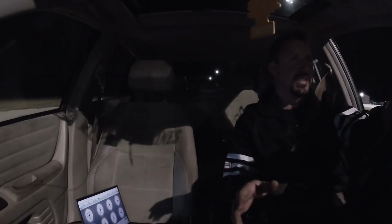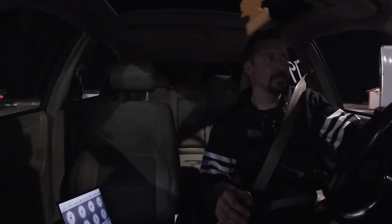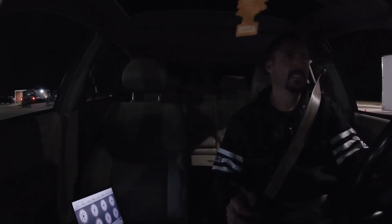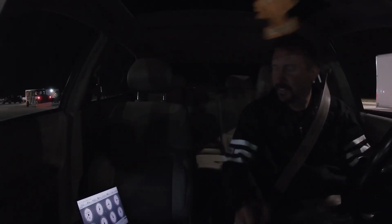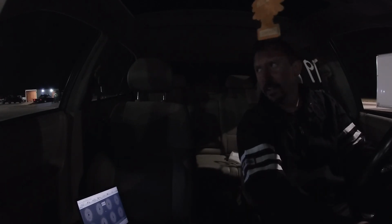So it was kind of controversial about the trans brake in general. They decided to allow it, and that's what cost us. Trans brake malfunction. It's too hot, and this solenoid, it's not even working right now. The trans brake gets too hot and it starts to stick. That's what I'm figuring out.